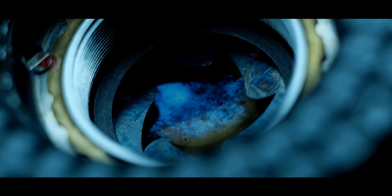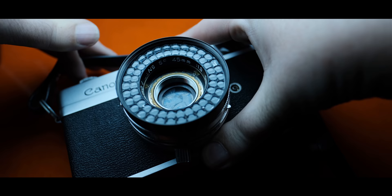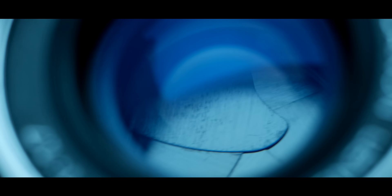But if it's glaringly off — like one second is actually two seconds — then there's definitely something wrong with your camera. If you're buying a camera with a leaf shutter or copal shutter, sometimes the leaves on the shutters will actually get stuck from oil getting on them. You can sometimes clean this oil and gunk off by pouring lighter fluid or pure alcohol onto it; it'll evaporate some of that stuff and sometimes you can get it moving again, but it doesn't always work.